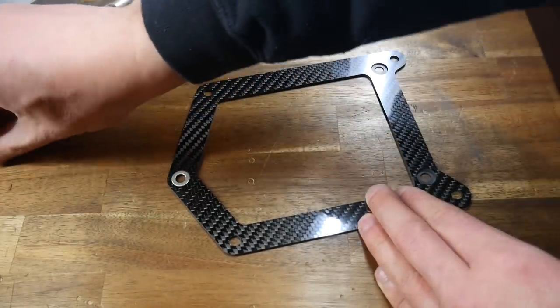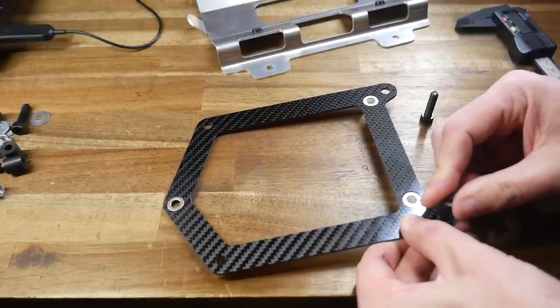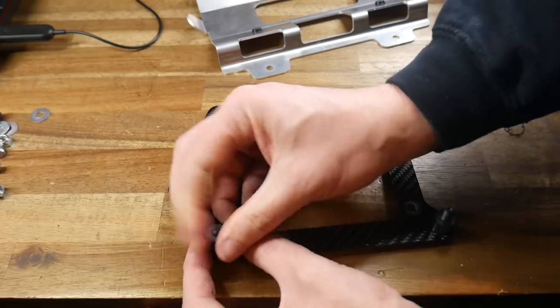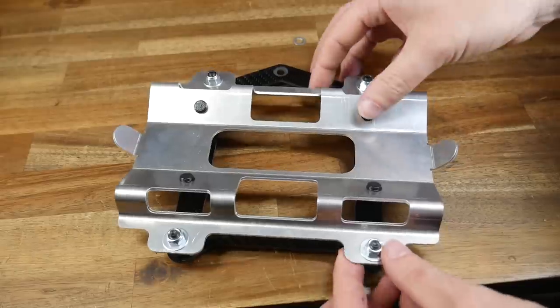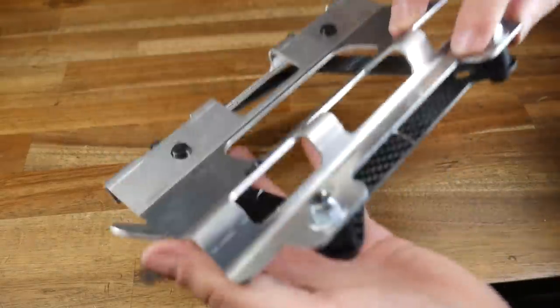This one was to be machined from 2mm carbon plate, and the only change I made from the prototype was adding recesses for the washers to sit flush. This adapter bracket in carbon fiber is absolutely flawless — the accuracy of those pockets is spot on, and the washers slot in better than I could have ever hoped for. The start of installing it happened on the bench, as I had to attach the bracket to the adapter using nylon spacers, which would soon prove essential in creating the clearance required to install the whole thing into the car.